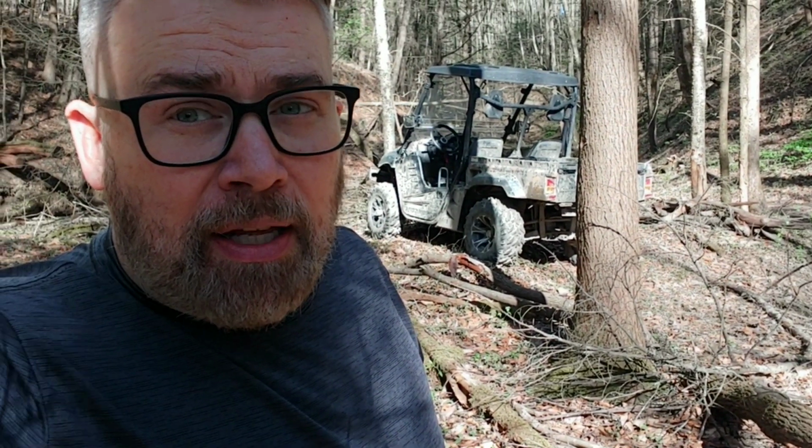But with that said, my local garage has been able to do everything I needed to do to it, and adjust everything that I've wanted to adjust myself. We changed the exhaust. It's just spring clipped in. It was no big deal. It's actually a pretty amazing design, the way it spring clips in. The spring clips allow it to give and take as you go over terrain, so you don't end up with metal fatigue and breaking apart. So I like that pretty good.